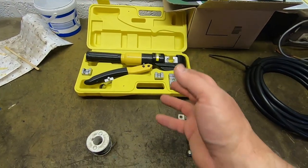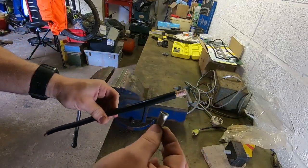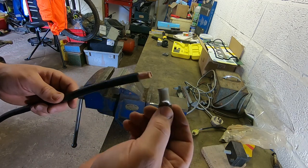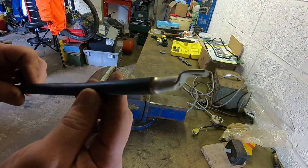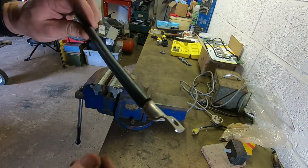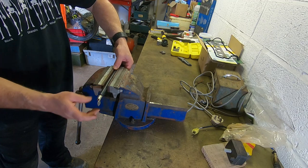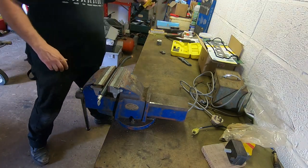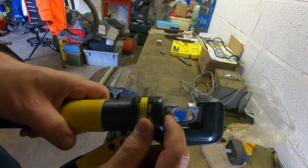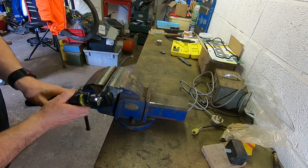Let's see if we can make a little cable. I found my cable, so I'm just going to put the lug on the end with a tiny bit of flux in there. I'll put a bit of heat shrink over it. Going to see if I can crimp it up — just putting this in the soft jaws with my crimping tool. It's got a 50 in there — let's just crimp her up and see what happens.